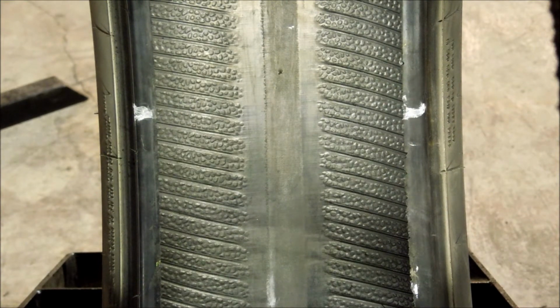Damaged rubber and steel should be removed from the injury using the appropriate carbide cutter on a low-speed drill with a maximum speed of 1200 RPM. Drill the injury from the inside of the tire following the angle of injury. Drill at least 3 times.